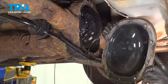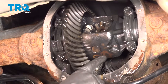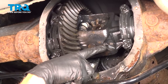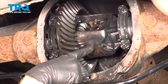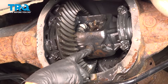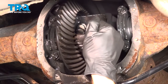The next thing you will want to do is put your vehicle in neutral. You can continue on by turning your drive shaft until you can gain access to the mounting bolt. You're going to have to remove this using an 8mm — that bolt comes all the way through the pin. When you remove this, make sure you're holding onto the pin; you don't want it to fall down and potentially get damaged by hitting the floor.